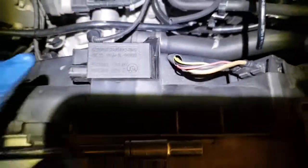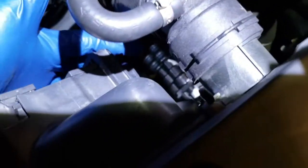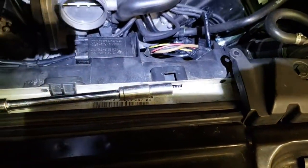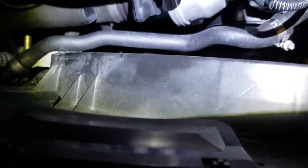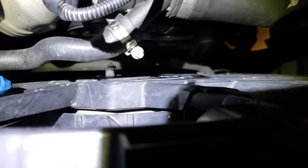I need to remove my fan. Easy enough. It's taking 1-2 tabs out, disconnecting and removing the little tabs, and having the cable on the side, and removing the fan plug. Once you remove that, all you need to do is pull the fan up, and be careful you don't catch the little hoses that go there, like right here, and there's another one down there that I have already removed. See, there it is, and the other one here also removed somewhat.